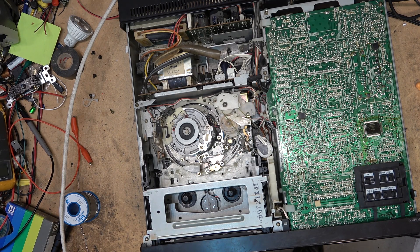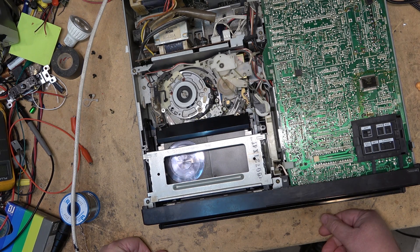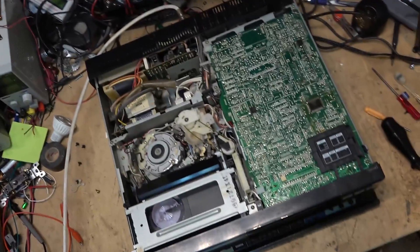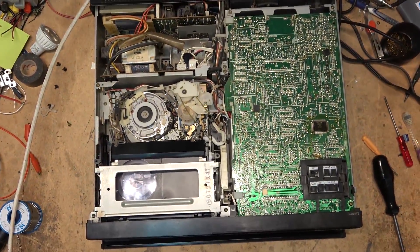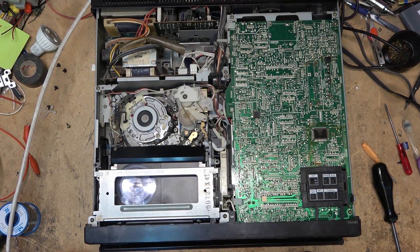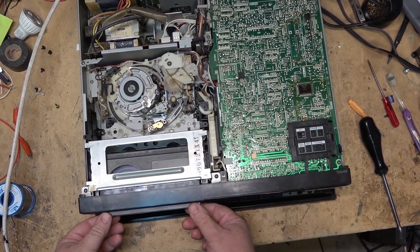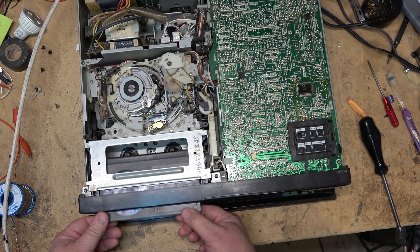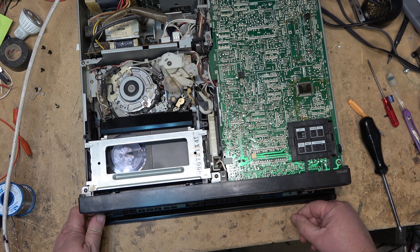Now this should load a little more smoothly than it did before. Just look at the way the tape goes in — just a very light press and the tape goes in. And play back. Then I'll eject. The tape is now completely ejecting, as opposed to before when the alignment was wrong and the tape only came out to about there. This way it ejects the tape a good half inch, which is what you want. Thanks for watching, we'll catch you in the next one. Bye.